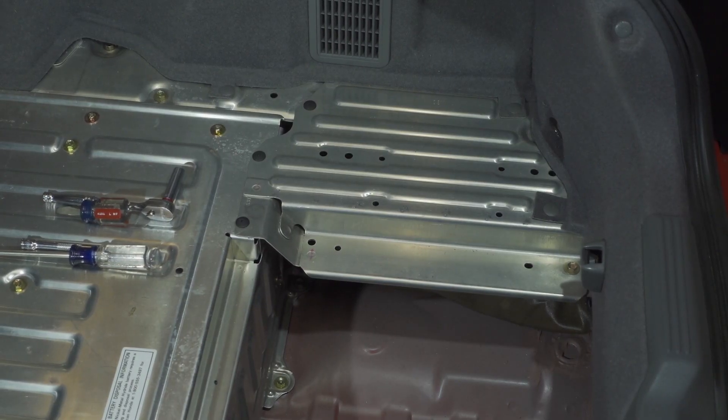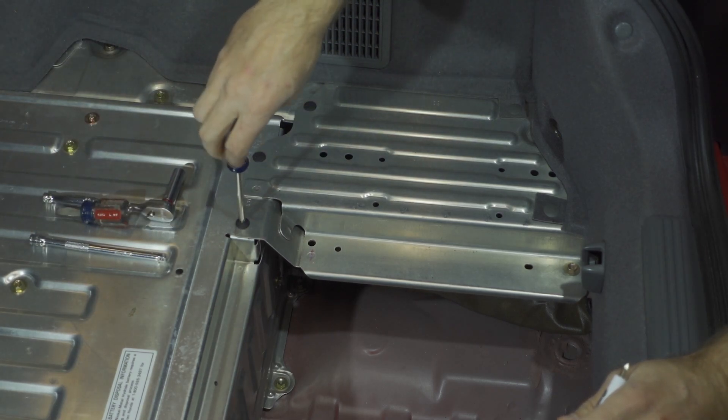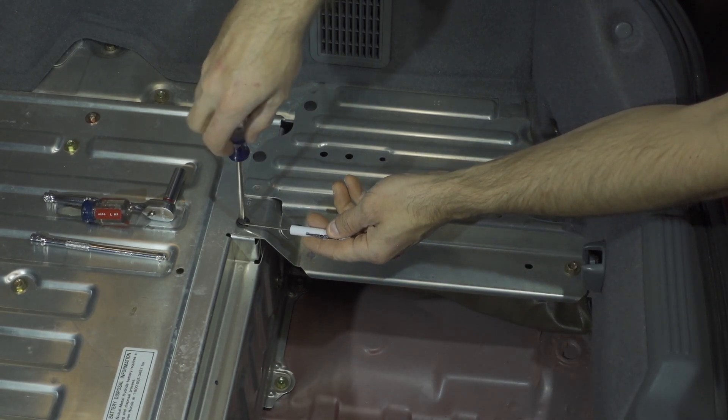To take the back right shelf off, you're gonna need a Phillips head screwdriver to unscrew these really odd plastic pieces. A lot of times if they don't come out — this one is coming out — but you can stick a flathead under here to help it out.